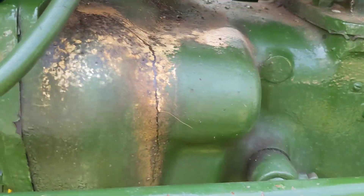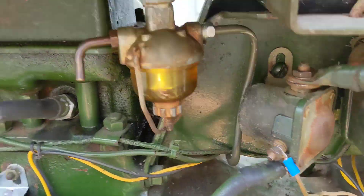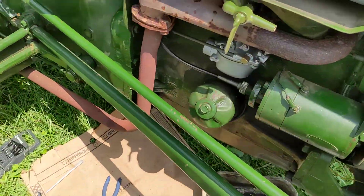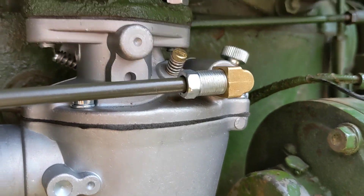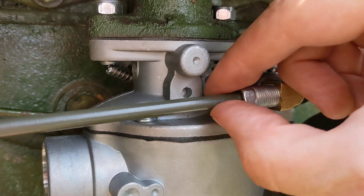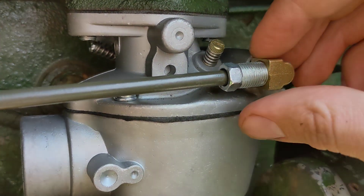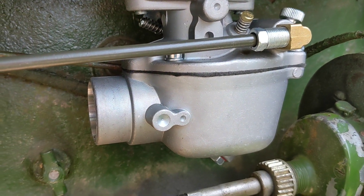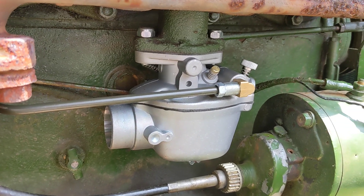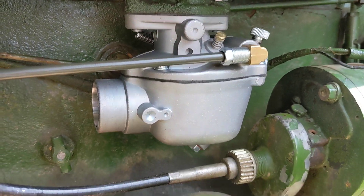Got fuel coming out the end into the pan. Got everything cleaned up and dried off. Moment of truth — two turns open on the main fuel. Didn't see any drips. Before I bother putting the air intake back on, I figured I'd just wait and see if fuel comes pouring out. Not seeing any leaks. Typically with these I'll snug them up and then wait — if I see a drip I'll tighten a little bit more. It's easier to crank it down another fraction of a turn versus stripping something out. That's dry, and hopefully fuel is rolling into the carb. I'm going to go ahead and get that air intake on and fire it up, give it a little test. I'm sure it won't start because it's on video — but hey, let's go.